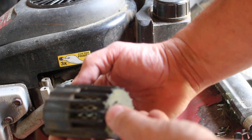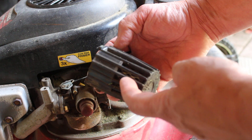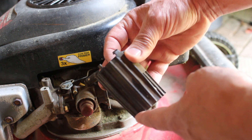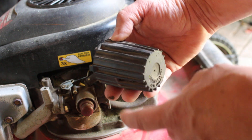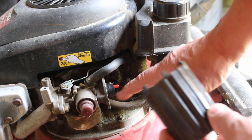So this is an actual air box, and if you look at the bottom, you can see there are openings where air is allowed to enter. Up top there are no openings because this side faces up — the idea being that you don't want rainwater going into the air filter, because that could allow water into the carburetor, and that would be bad.